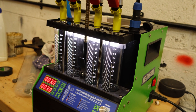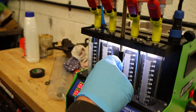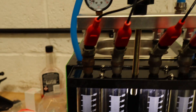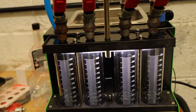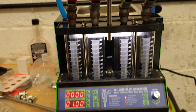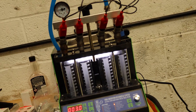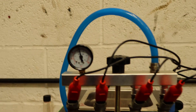So we are going to take the old injectors out and put them into the flow tester to see what they are like. I've just put the 430s into the GT. Now these are the injectors out of it — we're going to do a test on them. We'll do a leak-off test first to make sure pressure holds and there are no leaks. As said earlier, it's holding 5 bar pressure.